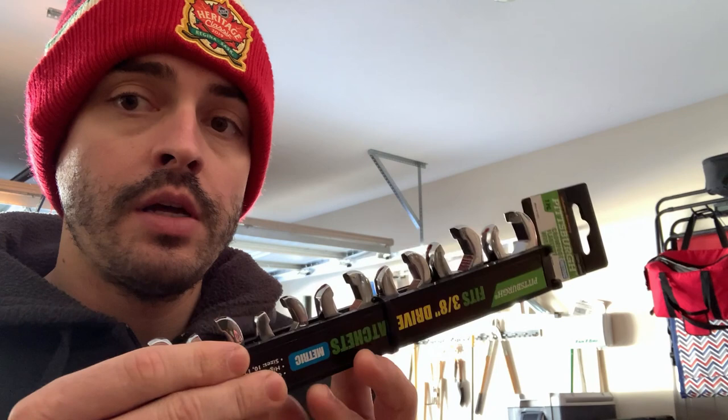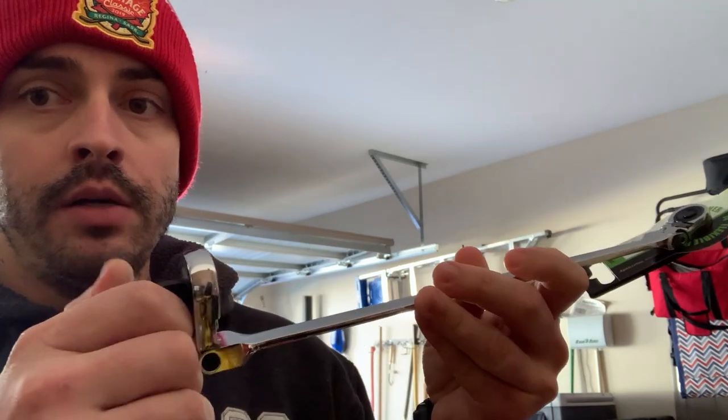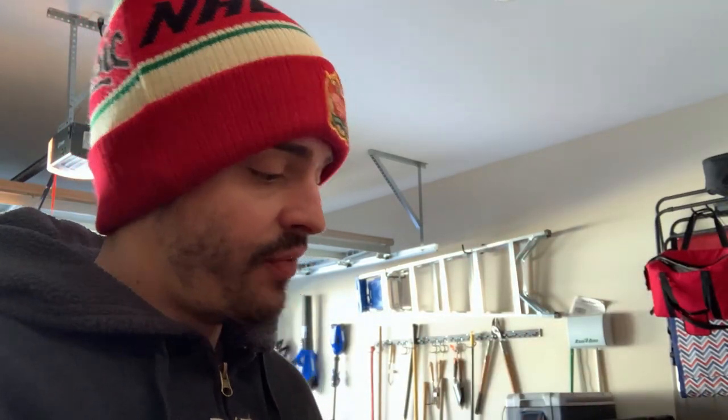Last resort, we're going to have to take that supercharger off and then put the fuel rails and fuel injectors back on while it's installed in the vehicle. That was the way I took it out, because I did not have the correct tools apparently. But we're going to try everything. We got some flex sockets here. We got crow's feet, or crow's foot. We're going to try those. I also have a flexible ratchet as well, and I have flexible hand ratchets as well. So one of those I really hope works.